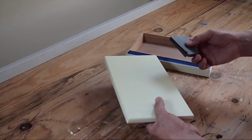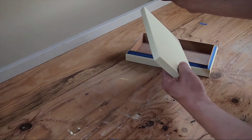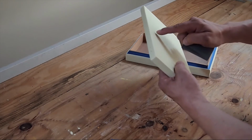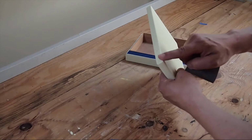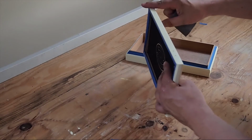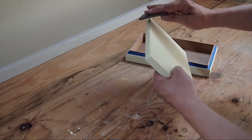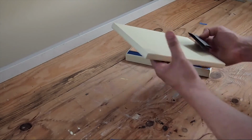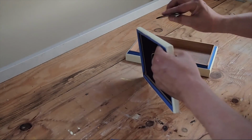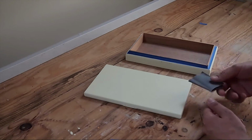I was going to mention when you're sanding this, anytime you have a corner, it's really easy to burn right through a corner down to wood or whatever the surface is. Corners are notoriously easy to mess up. Also with a buffer, if you're working on cars and you have a corner such as a fin. All you do on corners is just lightly touch them, and you'll notice that that's enough to take off whatever burrs from your primer and paint are on that corner. And then you can really get into the flat surface and get that smooth. That's just a word of warning about corners.